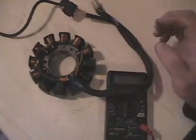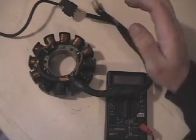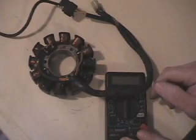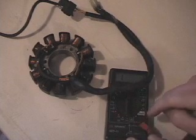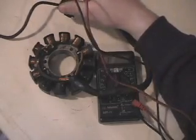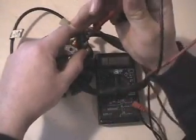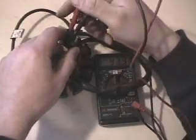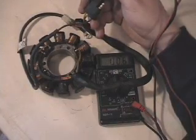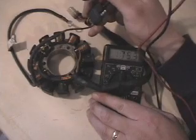On our multimeter — none of these ohm values are high, like 100 or 200 ohms. All of these values are going to be very low, with 18–19 ohms on the injector coils basically being the highest. I've got my multimeter set to 200, the lowest setting. Some digital multimeters just turn on and read whatever pops up. We'll start with our two yellow wires — we're just looking for continuity, which is going to be very low, like 0.4–0.5 ohms. You can see on the multimeter there: 0.5, 0.4 — those are your four large gauge coils giving you power.